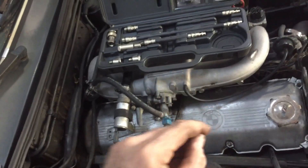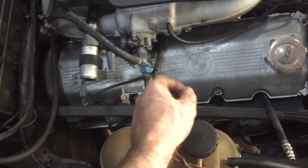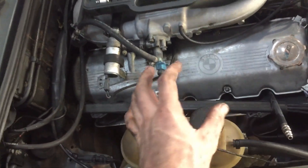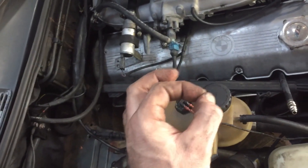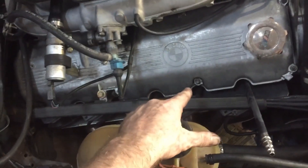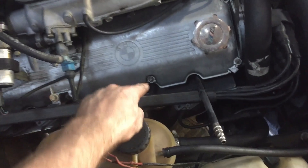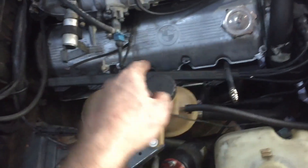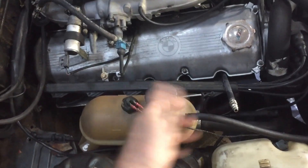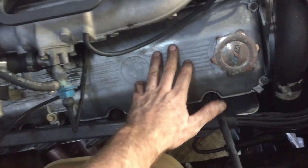There are a lot of different problems. The next thing I would do is go in here with some kind of magnet, scrape around in the bottom where the spark plug is supposed to be, and see if any metal chunks come up. Check your magnet and see what's on it. If there's nothing on your magnet, the next procedure would be to go inside here with one of these little tiny cameras with a little holder screen. You put the camera down in here — it's like infrared or has a light on it — and you can see. Sometimes you can see the crack in the piston or turn it up and see that the valve is open. But if you're not getting compression, there's no reason to fix this or get it to run. You have to tear this apart.